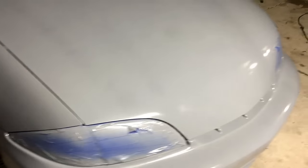Maybe I can show you that way or go to a gas station or something. There it is — this is Rust-Oleum Smoke Gray. This is the color I originally wanted to do on my Civic, but he likes that color way more. I'm going to show you up close — you can kind of see there's some sand scratches. If you use 320 to 400, you won't see those sand scratches when you paint. This does have a lot of dents here — that's not stripes you're seeing, it's actual dents. I just wanted to point that out. But overall, it turned out pretty good.